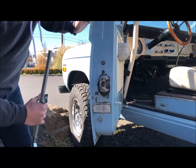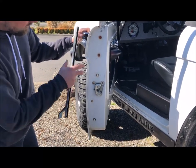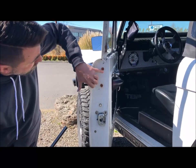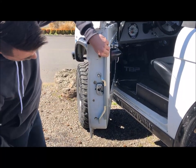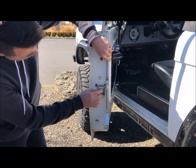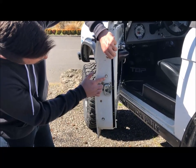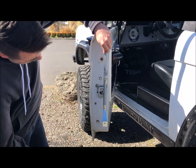Now we're at a 66 early model Bronco. As you can see, the door frame slides into the shell itself and there are three mounting bolts that mount the upper frame. This lowest mounting bolt is what would mount your door felt as well in the rear portion. That is why I have modified this felt and put a slot in it — so it would slide in between the outer shell and the upper frame and be held in place between the two pieces.